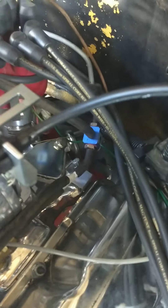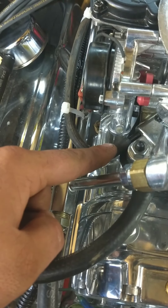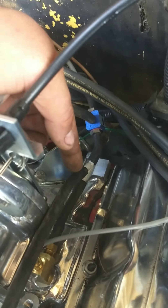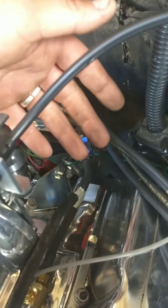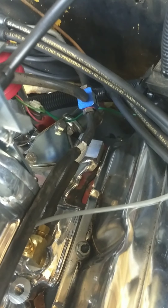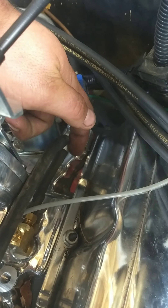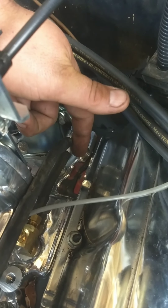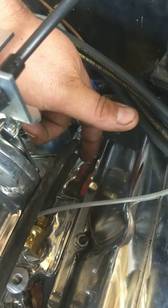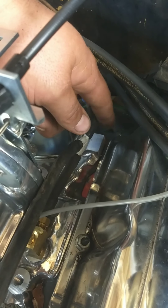First amount of pressure off of the manifold other than the gauge is going to be to our boost reference power valve. Then because the transmission works off of vacuum, I have to have a vacuum source. Before I added that blue thing, I just had a T ran to the vacuum port on the carburetor — not the boost reference port, just the regular vacuum port — so that under closed throttle or part throttle I would still get vacuum down to my transmission through this metal hard line to make the transmission shift. But if there was any boost, I still need vacuum to the trans to make it shift, so I basically just had an installed boost leak — I would never throw pressure towards the transmission.